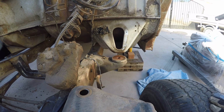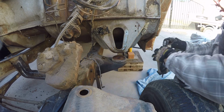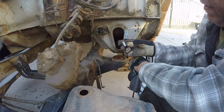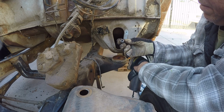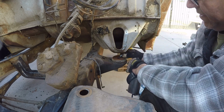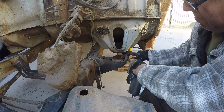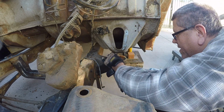Okay, so here we are out at the truck. Take this thing. This is an electrical nut for uni strut. See how long it is? You could weld 3 or 4 of them together too if you don't have these. You get these at Home Depot. My brother's an electrician. He gave them to me. I have a bunch of them. And it sticks out. See? Bottom's on the bottom of that bushing that's in there. If I had a regular nut, it'd be buried in there. You couldn't get a wrench on it.